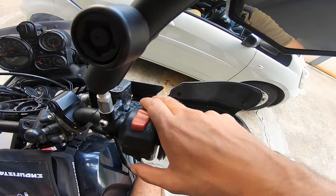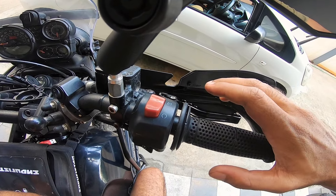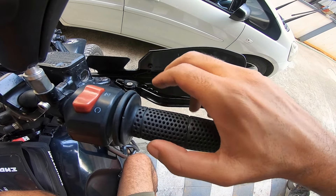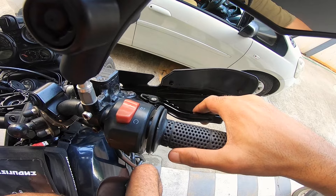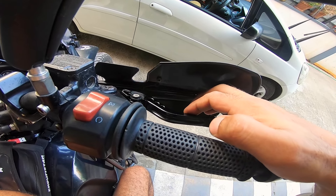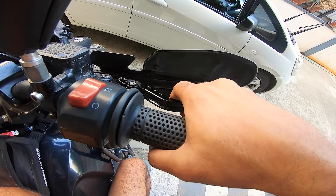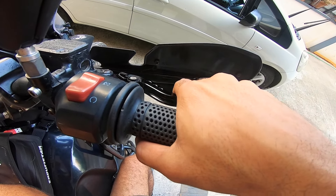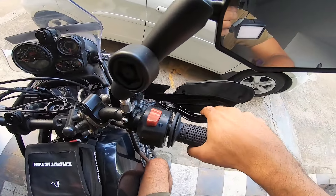The way this works — that's the best part — the way this works is leverage. If this was the usual long lever, you guys can see here, I've moved my lever away from the grip. That's to increase leverage for better braking. So the farther you're away from the pivot point, the more leverage you can generate. Long story short, this particular shorty brake lever is the right amount of weight, the right amount of taper, the right amount of angle, and the right amount of leverage.